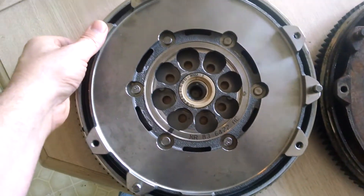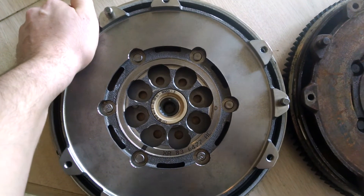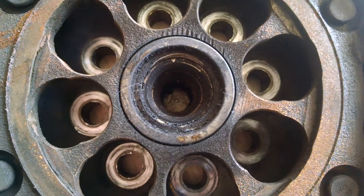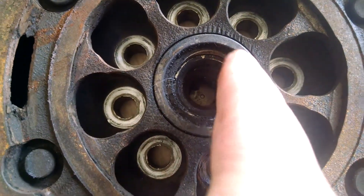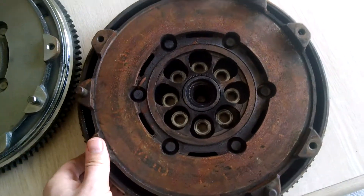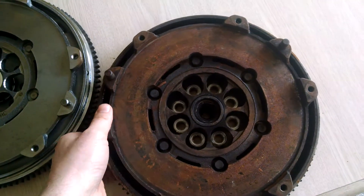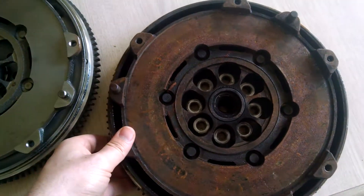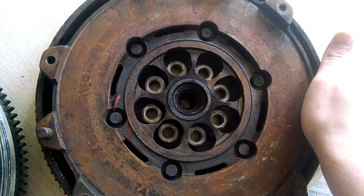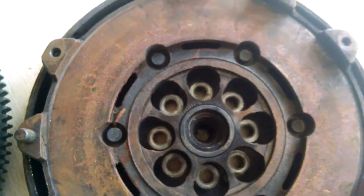Here's kind of the difference. This one barely moves at all, and when you press down on it, other than hearing the table wobble, no sound. This is the old one — if you look down here close, you can see where the seal for the bearing or the bushing has gone. Like a lot of dual mass flywheels, which are just stupid to begin with, it has some play in it — a little bit more when actually bolted up. Considerable side wobble play.